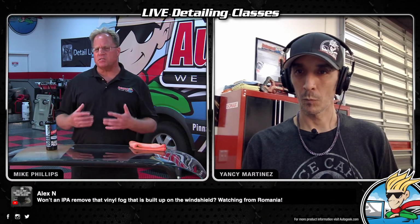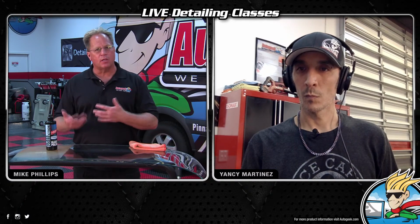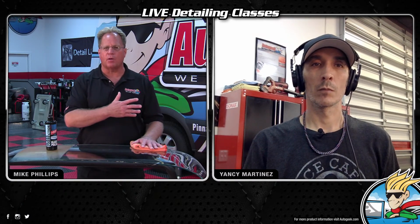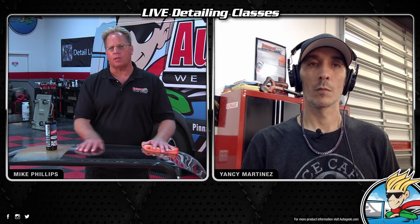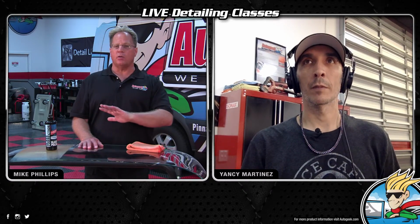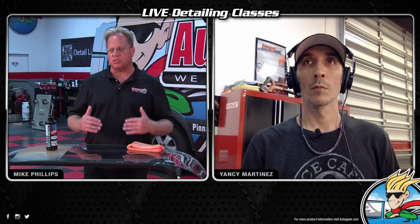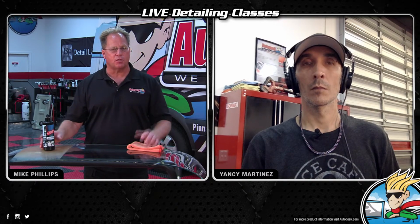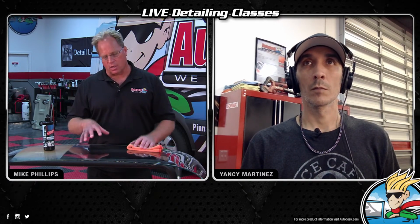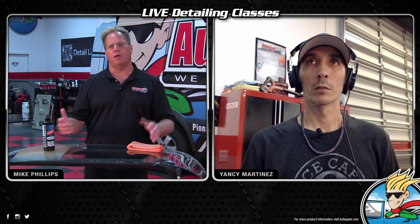But see, there's something to be said for mechanically abrading or polishing the glass to make it smooth and clean, besides just relying on a chemical. You're never going to get the glass as smooth as this feels from mechanically polishing it. Everybody can do what they want. I never argue with anybody, but I've been doing this a long time, and there's just something to be said for machine polishing with some sort of glass polish, or even clear coat polish on glass, if it's topical versus just wiping a solvent on there.